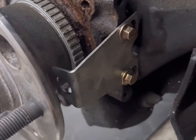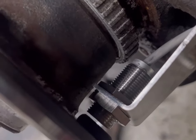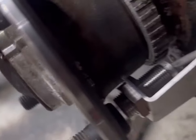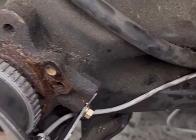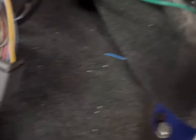Here you have the sensor bracket mounted. Give it kind of like 30 to 40 thousandths of an inch clearance — you can put some feeler gauges in there. That one's probably around 50 thou and that'll still be fine. Run the wire, get it out and over, then bring it inside of the car. I'm going to set that up, do the terminal, and then get back to the wiring. I'm pretty much just going to put the brakes back together now.